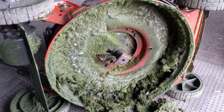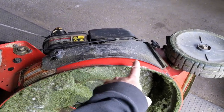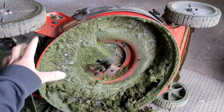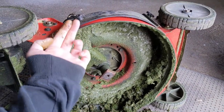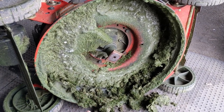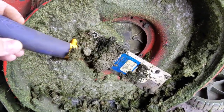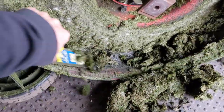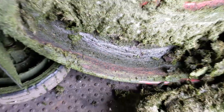This is why you want to be scraping all of the debris from your deck. Also, this is one of the cons of running a mulch plug. With the mulch plug, all of this grass builds up underneath your deck so you have to do regular maintenance and scrape this stuff out. You can see all of that stuff clogging up — we're just going to keep scraping all of this out, and right away it gets down to the metal deck.